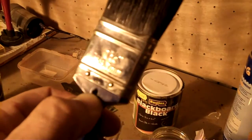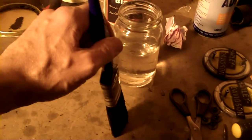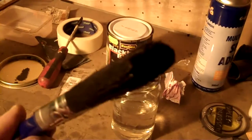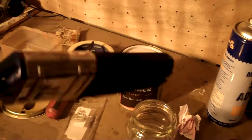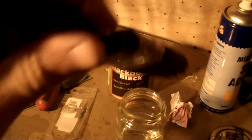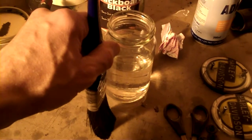What you've got to do with your brush is drill a little hole there in the handle. Now, if you put the brush in the jar, it sits against the bottom of the jar and does that. And all the solids that are in the brush get to the bottom, to that cut edge of the bristles, and it all just clogs them up, and the brush is useless. It comes out curved and twisted and kinked, and the brush is just rubbish. It doesn't look after them properly. They just sit like that in the bottom of the terps.